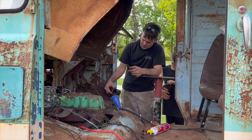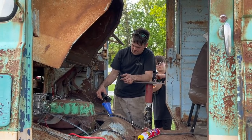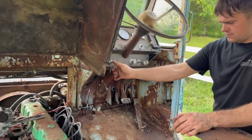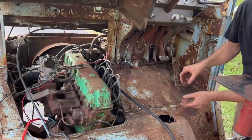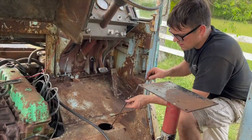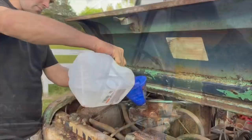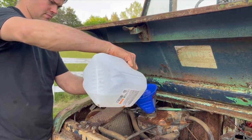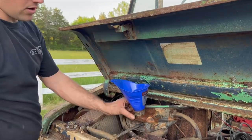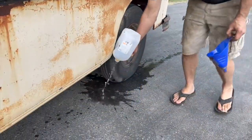Couple quarts in it wasn't showing up on the dipstick, but just on the tip. Probably need some, even though we put fluid in the last video we did of it. Breathe on that key. Oh, yeah, well, it went from not enough to too much, so that's perfect. I think we're low on coolant from where the thermostat hadn't opened before. It doesn't feel hot anymore.